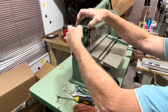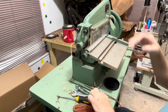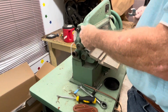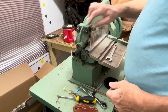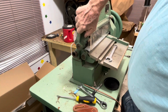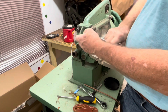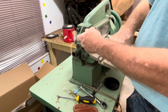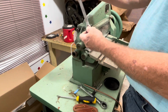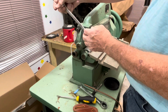Working on all my race cars and stuff like that years ago, I learned that the impact wrench is good for removing nuts and bolts and whatnot, but you don't want to use it to tighten them. Now, I wish I had one of my fancy ratcheting deals, so this would be done quicker, but I didn't go out and look for one, so too bad.